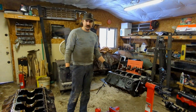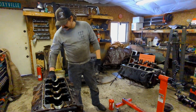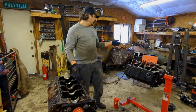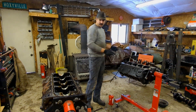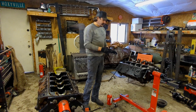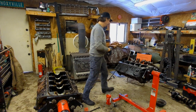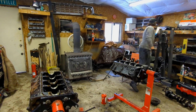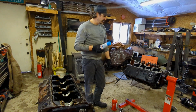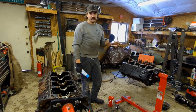Both motors are torn down and this one is cleaned up on the bottom. I couldn't get main bearings, which was bugging me, but it turns out this thing has what looks like brand new main bearings — and they're already worn into that crank. So we'll take the main bearings out of here, put them in here with the crank, and the main caps stay with the block. I'll have good main bearings and brand new rod bearings. I got some assembly lube — it's a really nice grease that works way better than the sticky oil stuff because it doesn't run away. We're putting the crank in first, then the pistons one by one.